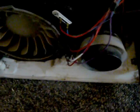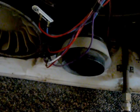Also, vacuum all this stuff out, this duct, the fan assembly. Try to clean up down around here as much as possible. This little grill here, this is exhaust for the drum area. These fill up with dirt, and that really reduces your drying efficiency as well. And anyway, put everything back together, put the back panel on, plug her in, you're good to go.